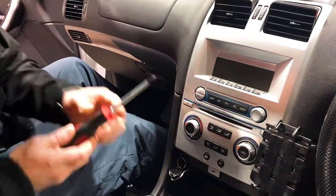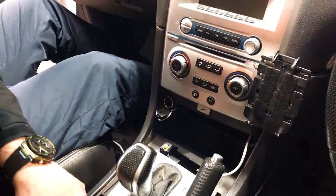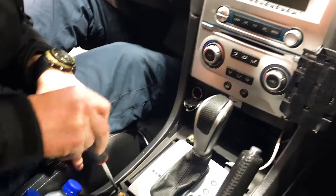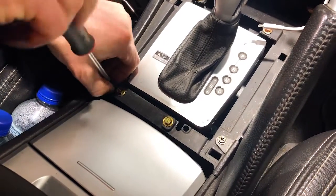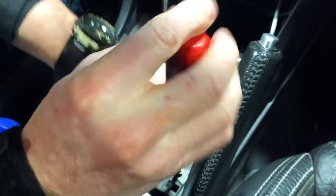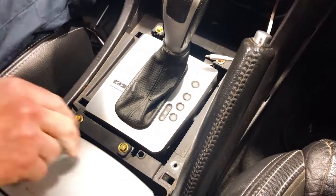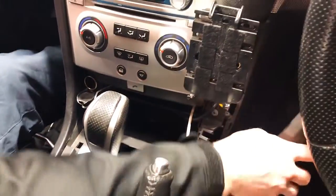Second step, screwdriver. You're going to undo these little panels. There's little screws on either side of the gear lever, so you can actually move that out of the way. Just here, little Phillips head screws. There's 2 of them. This panel on this car has been broken previously. You can actually see it's already loose here on the right-hand side, but we'll show you there's one here. Undo them. Anti-clockwise to undo it, guys, if you've never done one before. That just fell down. We'll pick that up later. This paneling will then slide out.